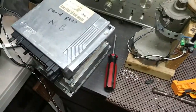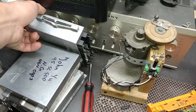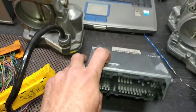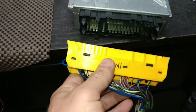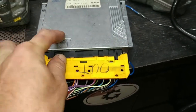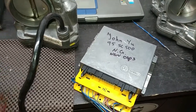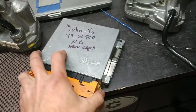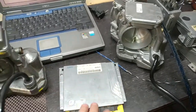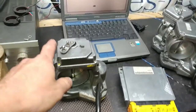I find a 124 unit — that's not the right e-gas. But this one here is a 129 e-gas and it should be a working unit; I changed capacitors on it and worked on it previously. This is an SL500 e-gas but it has the same wiring and schematics, so we should be fine. Throttle's connected — let's put the power on.